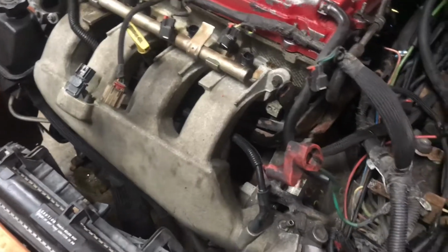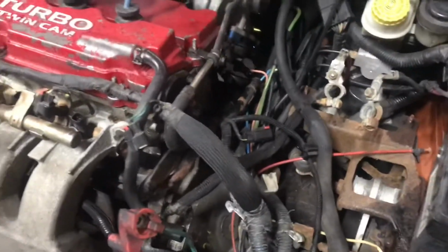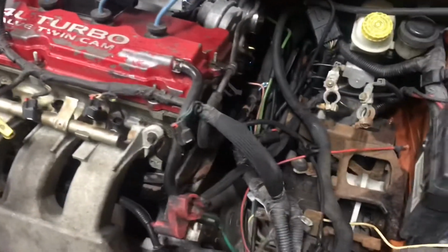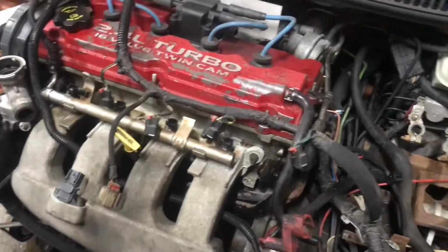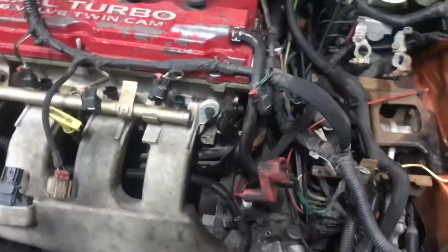All the intercooler pipes are unhooked. Then once I figure out the power steering lines, undo that, maybe loosen the throttle body or pull the throttle body off, I don't know. Then it'll pretty much be the downpipe, probably pull the whole exhaust because there's not a whole lot to it being a side pipe. Then it should be unhook the spindles, pull the axles out, probably drain the trans before I pull the axles, shifter cables, and then I should be able to unhook the mounts and get it set down on the ground.